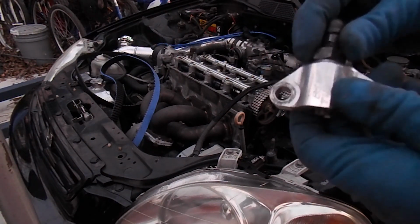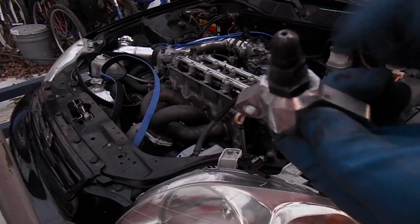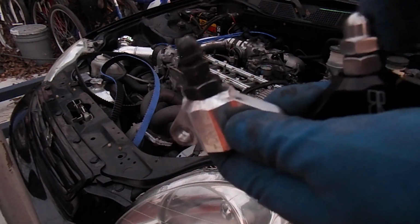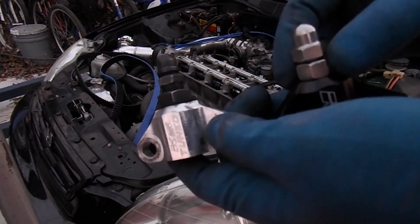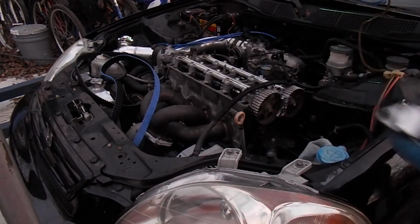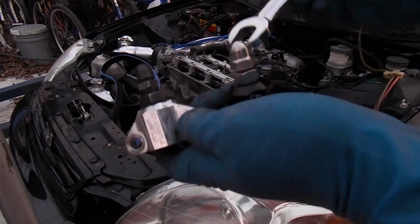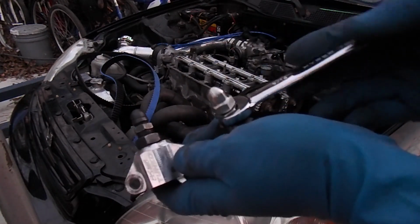So I went and put the belt on right now. One thing I don't like about this old model is it's really hard to tighten this big nut. The new model has a way smaller one. The nut that comes with it is the same size as the bolt you're trying to tighten, or the bolt you adjust, I should say. Whereas this one's really big. So, like this one, I believe. Let me check. Yeah. So this one, they said these are the same size. They're 9/16 on both ends.